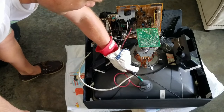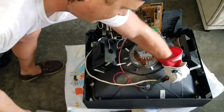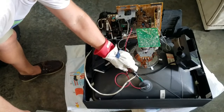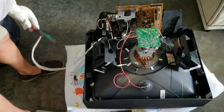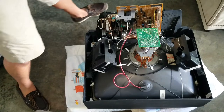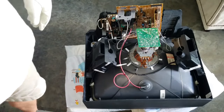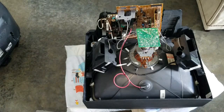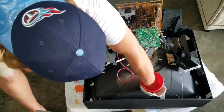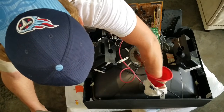I'm almost certain it's fine, but just to be safe sometimes the current will build back up in there even after you've discharged it once. It seems to be good. So definitely on the Trinitrons, the manual says do not use a sharp tool to disconnect the anode cap. It says you basically just got to pinch it and pull it out carefully so you don't damage it. So let's go ahead and do that now.